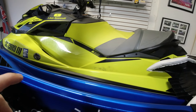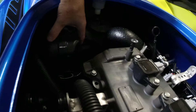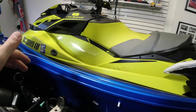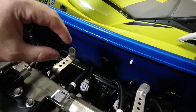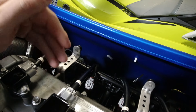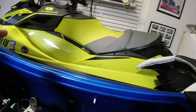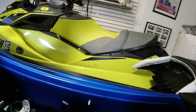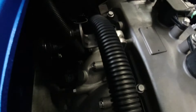This Sea-Doo has something similar in their intake manifold. There's an actual air filter in the box here. The Sea-Doos, their box just sucks air in, but they have a filter stuck in the intake manifold that you'd have to drill out. So if it got dirty or whatever got in there, it'd be in there permanently until you drill it out. Maybe that'll be a future mod I'll do on that — if I don't need to really go in that area, I'm probably not going to go in there.